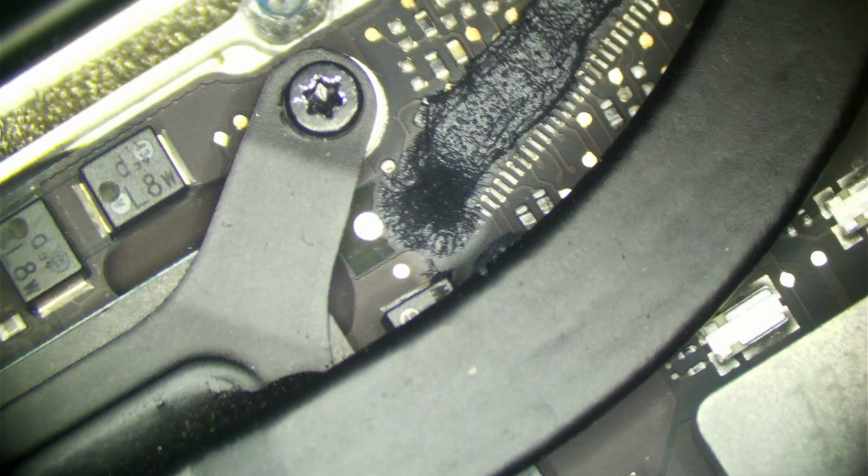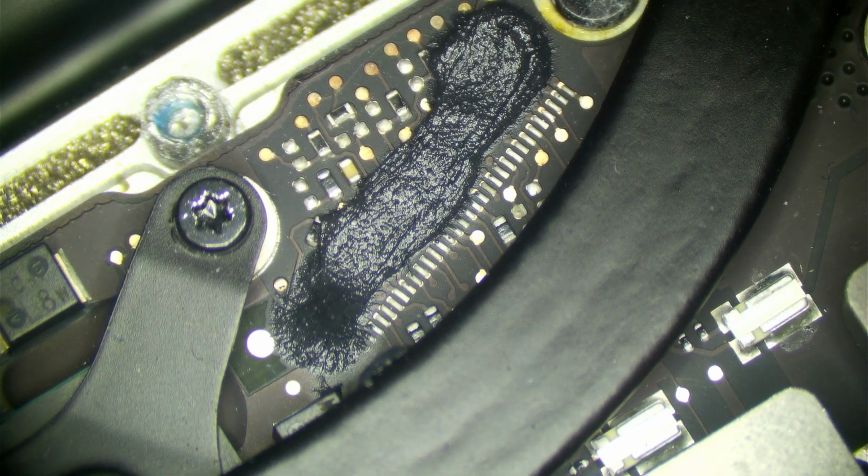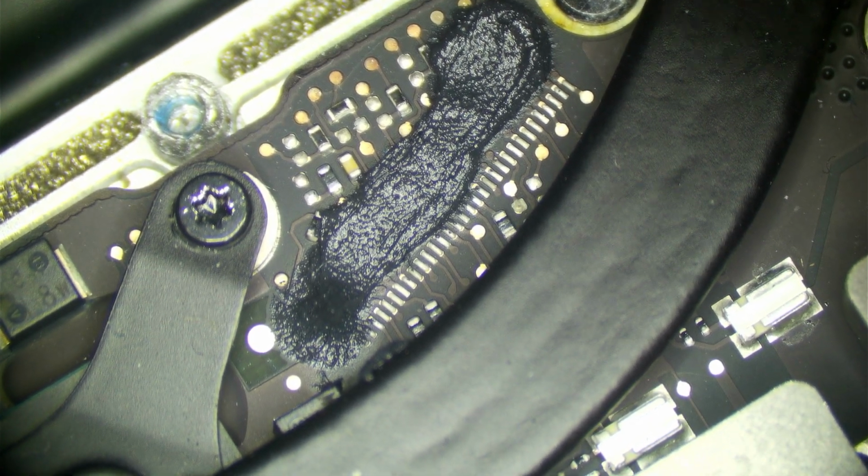And this area is kind of like a JTAG connector that's not present on the board for our PCH, which handles many PCIe functions and SSD functions. It also has the memory controller in it. And you could see that there are no apparent conductivity issues. And lastly, here is our CPU JTAG and diagnostic port. Same thing, thermal compound all over it with no issues present.